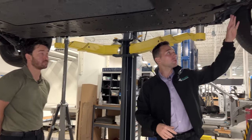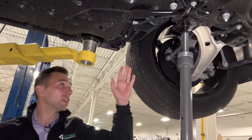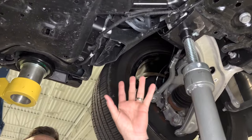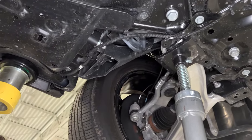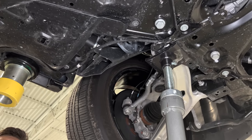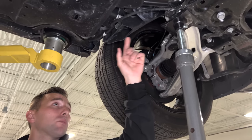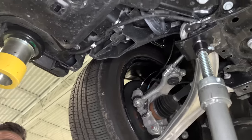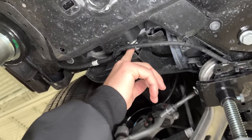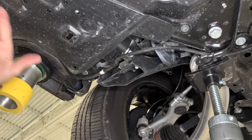And as we look upstream of this, they're doing some other things that also speak to the fact that they're very, very focused on this whole concept of leveraging airflow and letting ambient air out. You want to get that stagnant air out, fresh air in. These ducts and or protectors right here are twofold. If you look at these, they are protecting some of the thermal management lines that run underneath and into the pack over here.